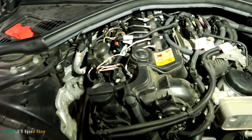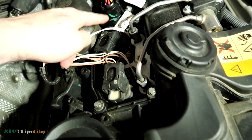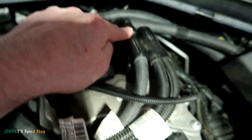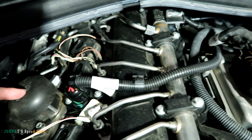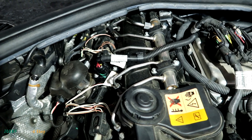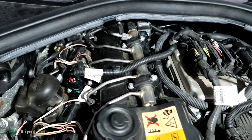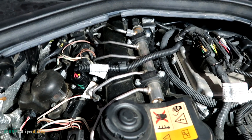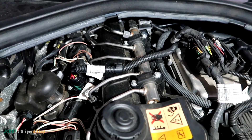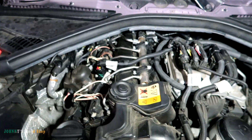This is the valve itself here, this is the harness for it — it's a very short harness that goes from the ECU right back here, it's tiny. So I pulled the harness off, I checked it, did continuity tests on it, did all that stuff — it looked perfect, all the pins were brand new, nothing. I did do a pin fitment test on each side of it, it was fine, yet I still kind of jammed them in a little bit just to make sure.